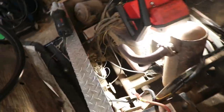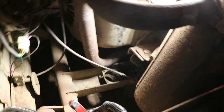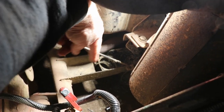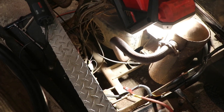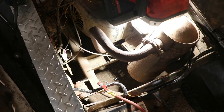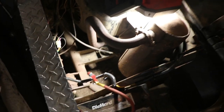I've jumped into doing these motor mounts just because no need to have you guys, gals all watch me struggle here. So the factory ones are just riveted in. I was able to take all the motor mounts out and move the engine around enough to get access. Any ones that I couldn't drill, at least semi close to straight, I've just been grinding the top of the heads off and then knocking out what's left of the rivet with a punch and hammer.